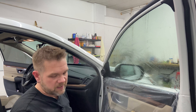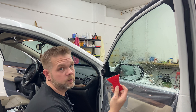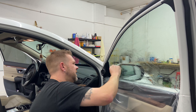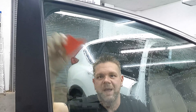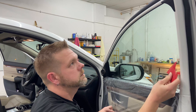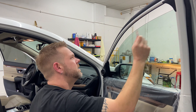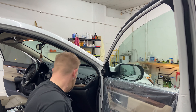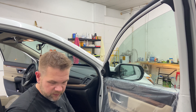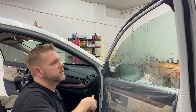So we're just gonna plastic it. I've got a plastic gator blade, which is great for scraping glass — we're just gonna go across it. We're really just looking to knock down anything that might be kind of stuck to the glass. Pull our window down, get in those edges, those sides, scrape across the top. This is my method of doing it. It works for me and I get very clean installs from it.